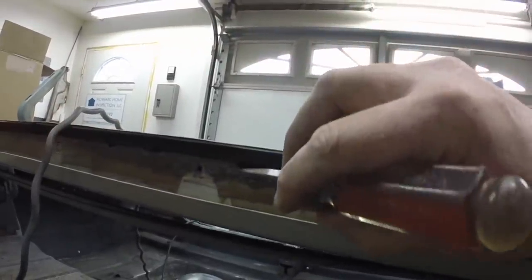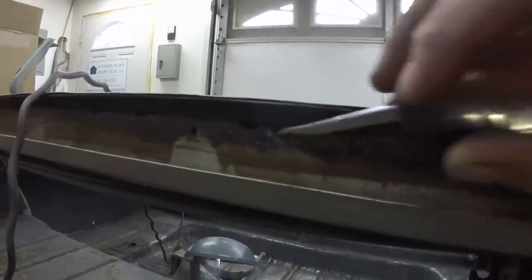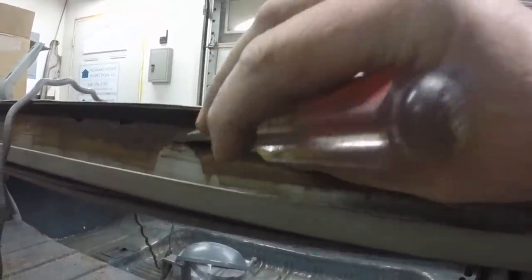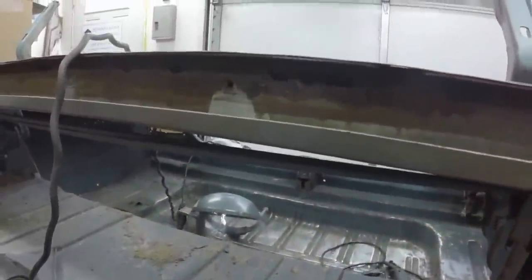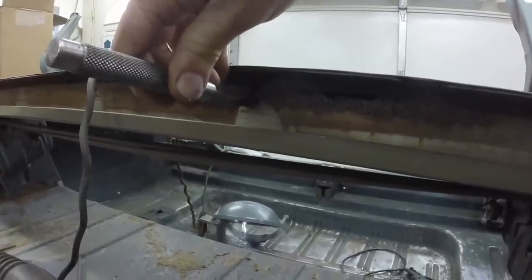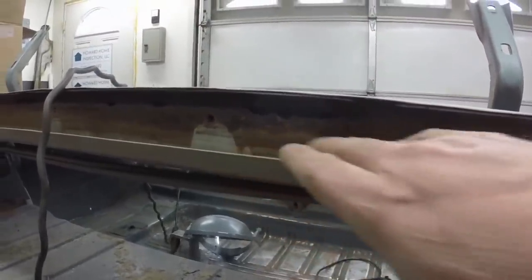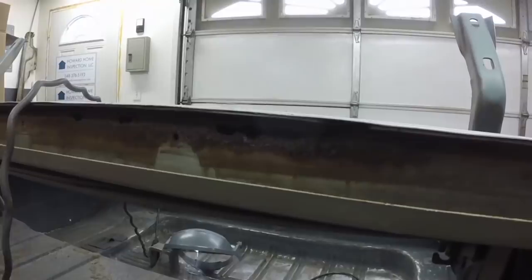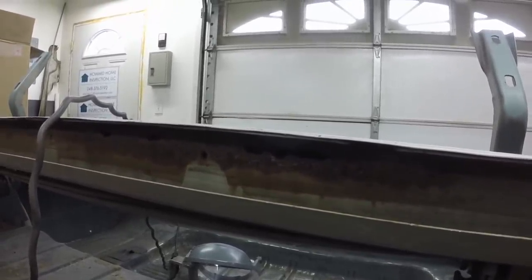And that's fairly heavy metal. I have some thicker gauge like that, and I'm going to just cut out where it's all bad and weld in new and grind the welds out, because the top has got to be smooth. And you can see this bolt hole needs to be hammered back. I've just been taking a hammer and a punch and going around the hole and pounding them back so that they're flush. I'll finish doing that and then I'll cut the rust out and make some little pieces to weld in and get that taken care of.